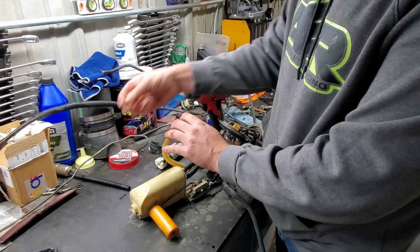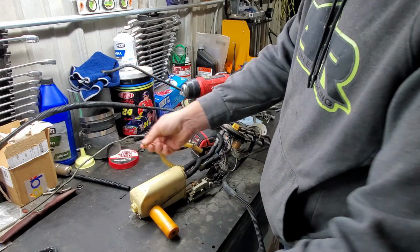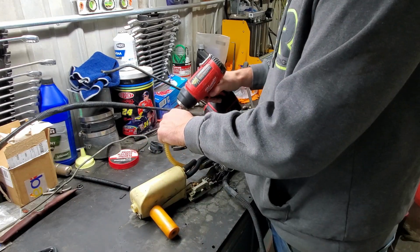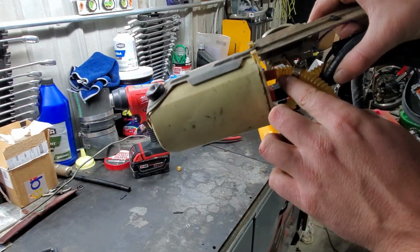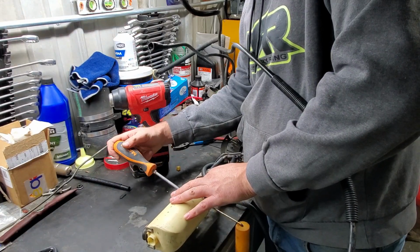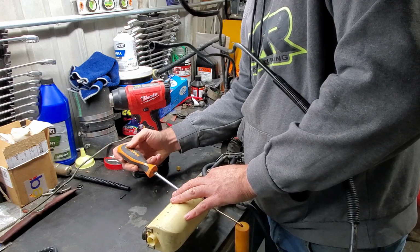What I usually do is I trim off the end that was swollen to the larger pump, and then when it's narrowed down to that thin slice, I will heat it up and push it over the new pump. You can see how nice it's gone all the way up on that pump. And tighten this hose clamp. Technically, you shouldn't need a hose clamp if it's a barbed pump. This pump did not have a barb on it, so we're going to use a nice little hose clamp.